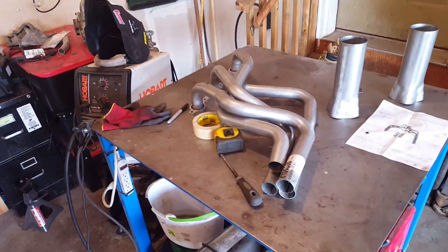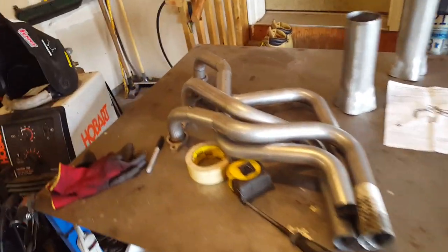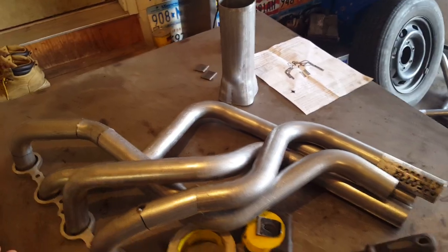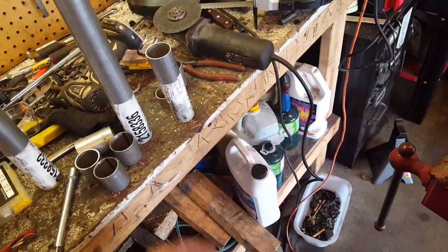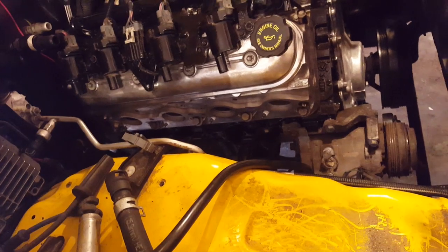Working on the headers now. A lot more difficult than I thought they would be. I already cut a bunch of places. Cut and bend and trim and stuff. They give you so much extra. At first I thought it was just going to be a bolt up per piece, but there were lots of little pieces and chunks I had to cut off. Trim the ends, and then still the angles are all off. Something big or a huge truck maybe would fit different than a Colorado.